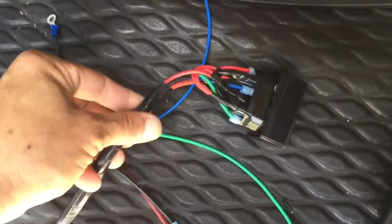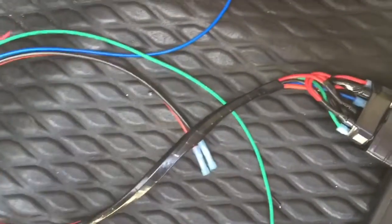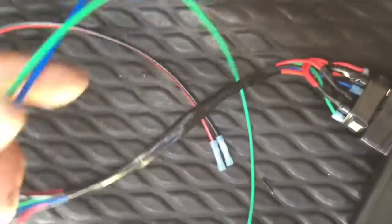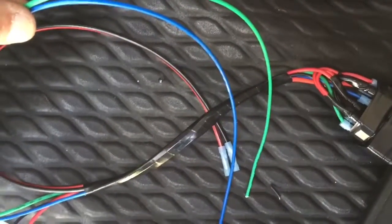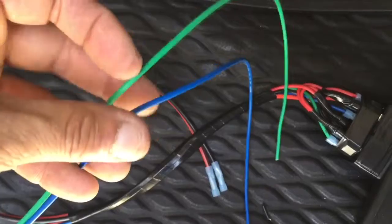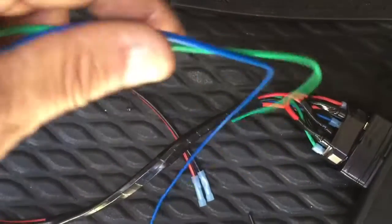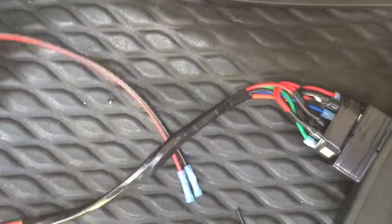This is the relay that comes in every kit. The black wire goes to ground and already has a ring connector. The red wire goes to positive. This is the negative trigger from the alarm — whatever alarm you decide to hook up. The negative input: once you hit lock on the remote, green is lock and blue is unlock. That's the standard color wiring in the alarm industry.